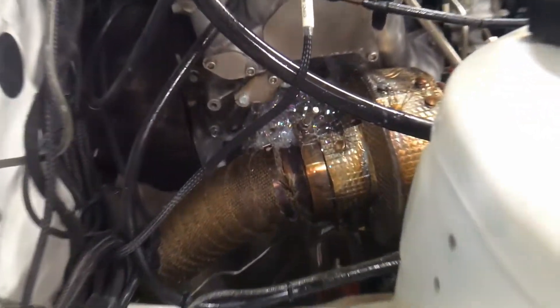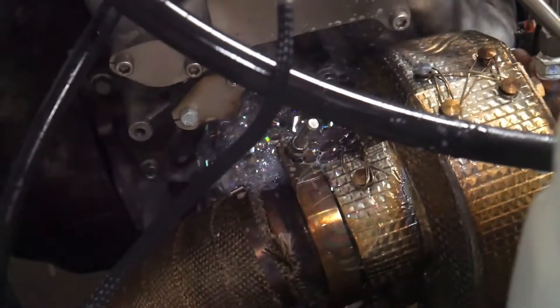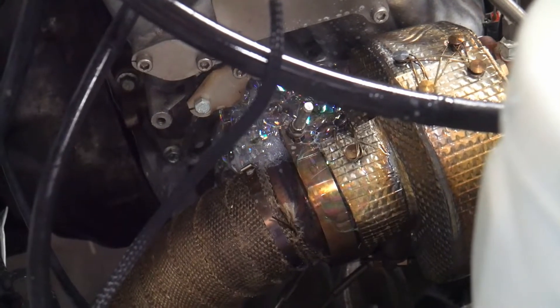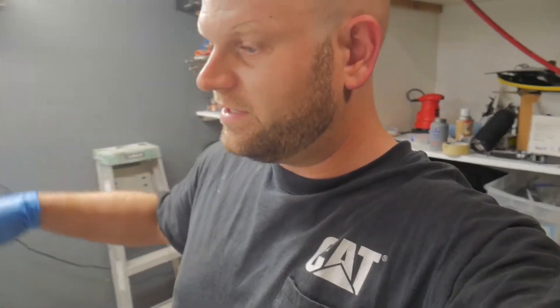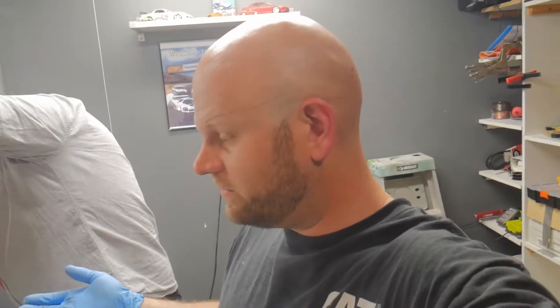We're going to move on and test the exhaust manifold gasket, which is critical. This is a disaster — everything is worse than when we started. Fresh gaskets on the exhaust manifold, and this V-band clamp, we just have to take it off and put it back on again, hopefully it seats better. We went back in, got everything tightened down, took the V-band off, re-tightened it, realigned it. Everything is still just bubbling like crazy, unbelievable. The only thing we can think of to do is try and heat cycle everything, then come back and see if we can make any adjustments.